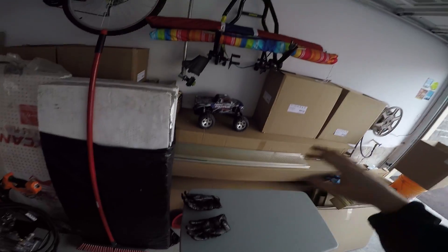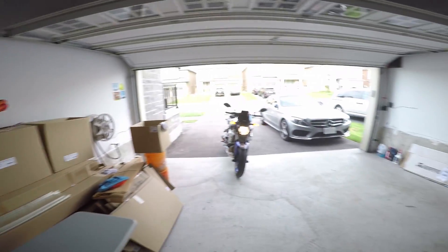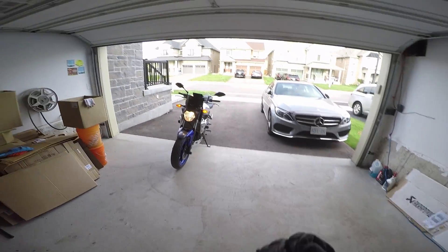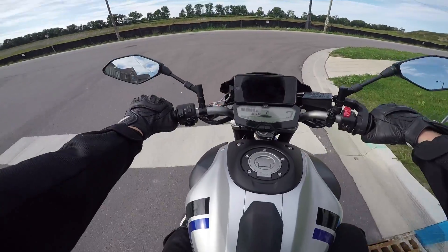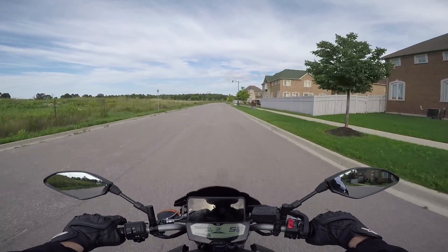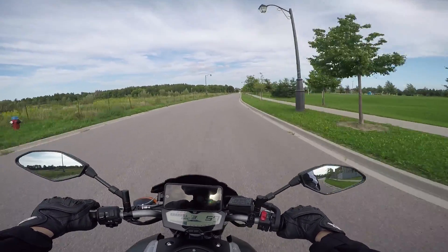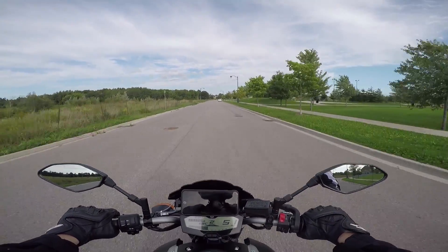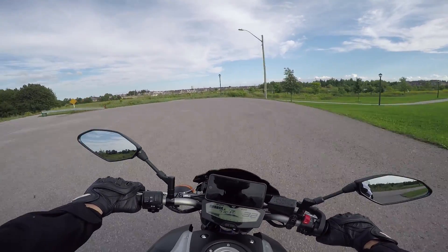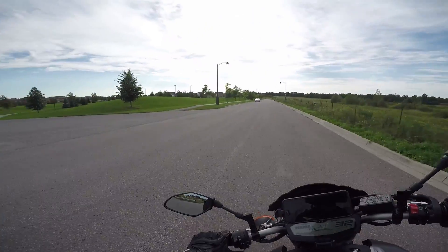I'm gonna get out of this area — I'll just give it a tiny bit of throttle to get onto the main street and then I'll give it a pull to see how it feels. I disabled the decel fuel cut so there's less engine braking — I'll feel that right away — and the actual power I'll feel once I'm on the main street. The first thing I noticed right away is the fact that there's no engine braking. This is amazing! I think it sounds a little bit different too. On a downshift — yeah, it definitely sounds different. And there's no more pops, which is good, because pops mean the bike is running a little lean.